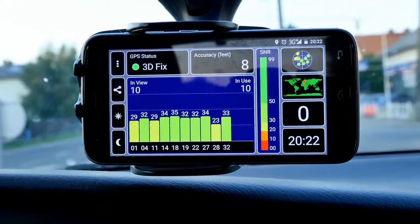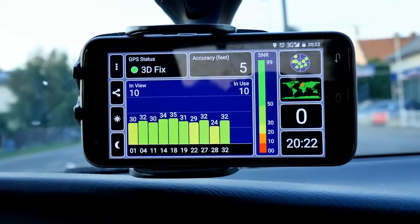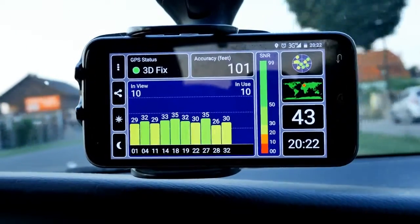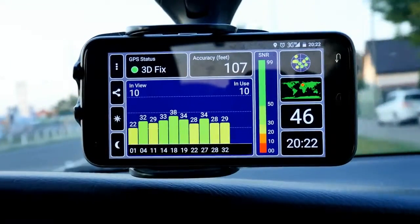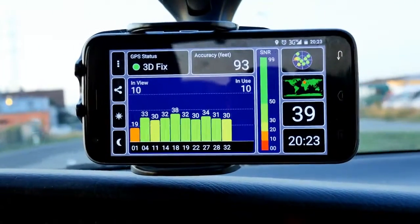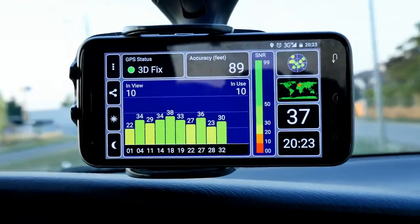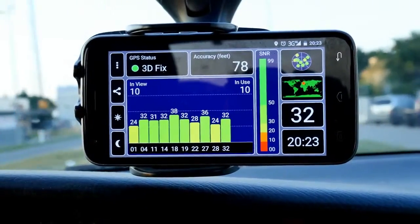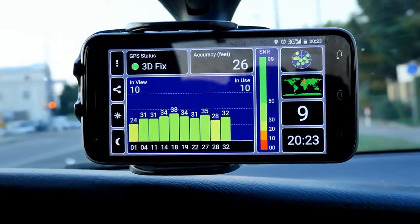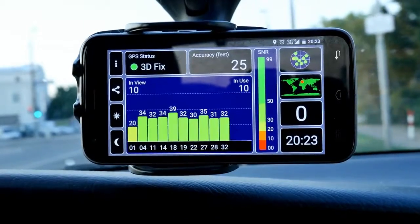Here's a quick GPS test. If you've seen my other MTK6735 reviews, GPS reception was usually very bad on those phones. But on the Y100 Pro, GPS reception is really good — we have 10 satellites in view and 10 in use. The chipset doesn't support GLONASS so it's limited to 10 satellites, but the signal bars are mostly green — signal level over 30 dBHz. Accuracy is pretty high, partly thanks to Android 5. Doogee did a really good job on the antenna design.